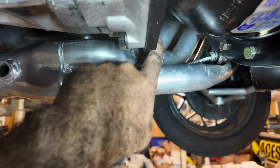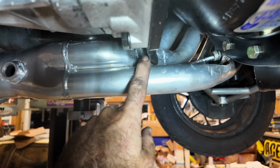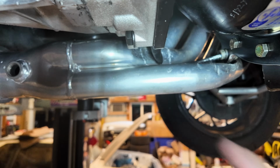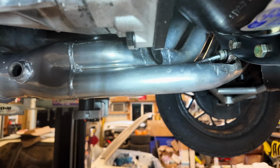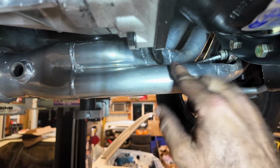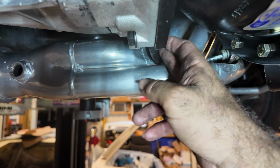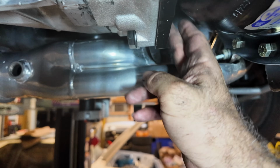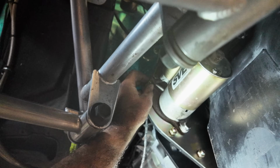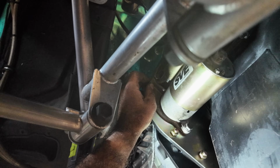This is your clutch fork, and that's not a very bad angle at all. See this? Should have plenty of throw. Granted, if we can get the nut back here started, it's gonna be fun. We have a McLeod clutch coming, and when we do, we're probably gonna go ahead and throw this adjustable pivot stud in just in case, all right? That way we can make sure that this angle is correct. Starter-wise, this just bolts right up, no problem whatsoever. Ooh, I need to tighten that up. You can see that. That's loose.